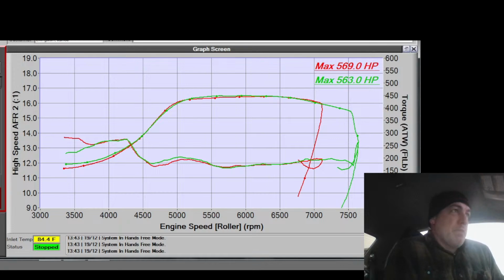Only took a very small adjustment to the knock threshold to get it to not throw knock from just piston slap noises. I can't hear the piston slap when it's running, but the knock sensor can. So it didn't take much. It took a 0.2 to the map, to the table there, around the 4,000 RPM range. And these are low anyways. Like I said, this vehicle came in really low as it was at 3.1. A lot of the STIs are up in the 3.3s, I think, from the factory, if I recall correctly. And so I put it pretty much around the stock location of like an 08 STI. So that's cool.